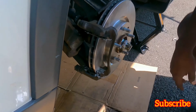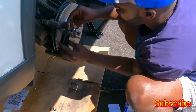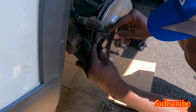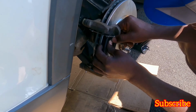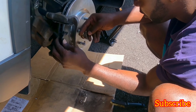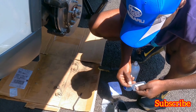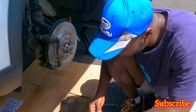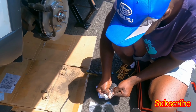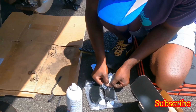Okay, now gotta put the brake pads on. They are directional, so make sure you got them properly on. Snap. Ooh, actually, I forgot something. Before I put the brake pads on, put a little bit of grease on it. All right, guys, so this is brake grease. I forgot there's a name for it. I can't remember. I'll put it in the description. Just a little bit on it.